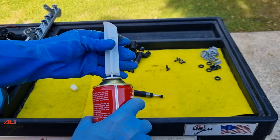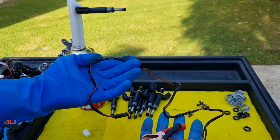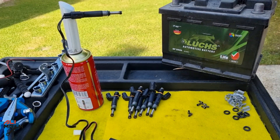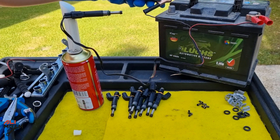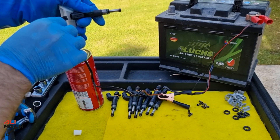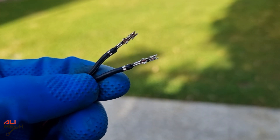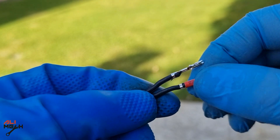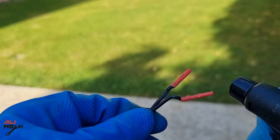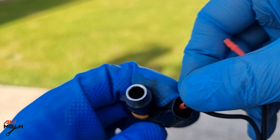Put the adapter first, then the injector. The fuel injector adapter comes with two wire harness connectors for powering the fuel injectors — you just need a 12-volt battery. It doesn't matter which wire is positive or negative. When you apply voltage you should hear a clicking sound at the nozzle. Right now there's no sound — it's not working. I had to fix the connector because the wires were too far apart, then I put heat shrink on it so the wires don't touch each other and create a short circuit.